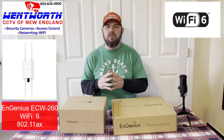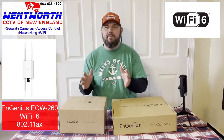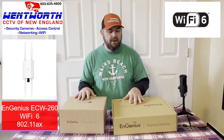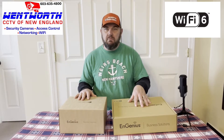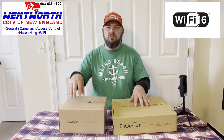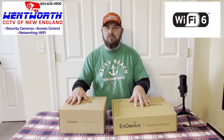We want to accomplish this using the new Wi-Fi 6 802.11ax MU-MIMO technology — Multiple Input Multiple Output. With a gigabit switch, these access points on the 5 GHz platform allow us to use up to 1.2 Gbps of bandwidth. On the 2.4 GHz frequency, that's about half of that — 574 Mbps.